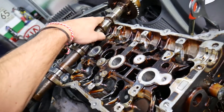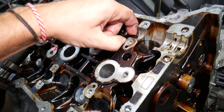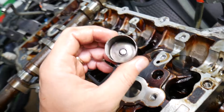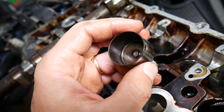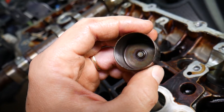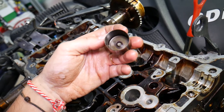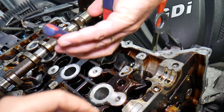So the clearance between the valve and camshaft must be within spec — if it's out of spec, it causes valve lifter noise. Now, that's a valve lifter right here. My fingers are pretty oily, but let me remove two of them to show you. This one — you can see on the inside — it reads 3.360. That's the thickness of that valve lifter.